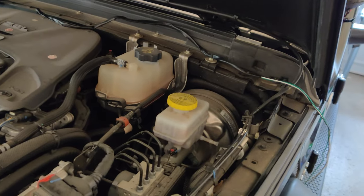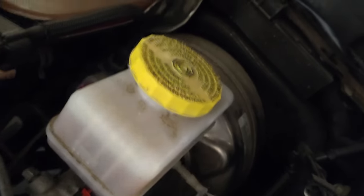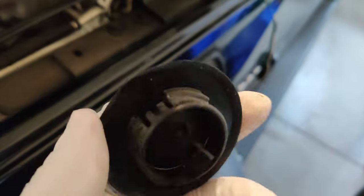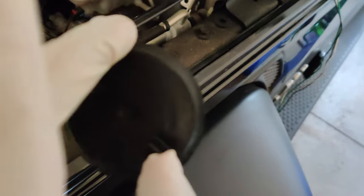The easiest way I found to fish wires safely through the firewall is this hole here — it has a plastic cover that just pops in and stays. It's a factory feeder that comes with all Wranglers. I used a small screwdriver to pry it out from the side. That gives you a clean opening to fish your wires through quickly. I'll use a torch so you can see — that black hole there is the easiest way to get inside the cabin without drilling.